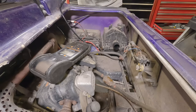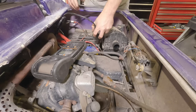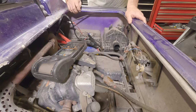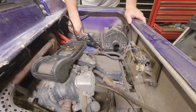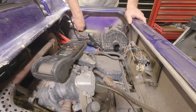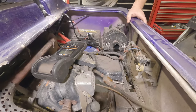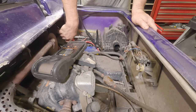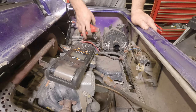I'll take this battery tester — I just want to see if it's going to give me any sort of reading. We have a 525 cold cranking amp battery, it's a group 70. Not sure what the year is. Look at that — never mind, we're not even going to be able to do this test because the meter won't even turn on. I'm willing to bet that we have a bad battery.